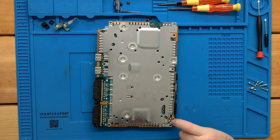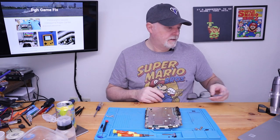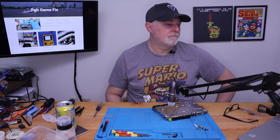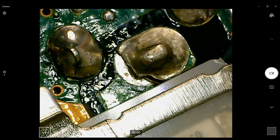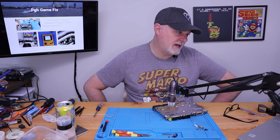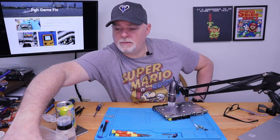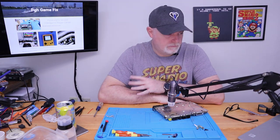What you can see here is you have the two ground posts, and this is your power. A lot of times as it gets bent and wiggled, it cracks. And, matter of fact — yeah, I can see the crack in it already. I'm going to set up the microscope. So now we've got the microscope out, and if we look over here you can clearly see that positive trace has just cracked. This whole connector is just loose. The most simple fix is to press it firm into the board and push all the solder joints back down. There's actually a little bit of that solder pad left, and we can bridge it. We'll also use a little piece of high-strand silicone wire and just jump it to a clean spot.